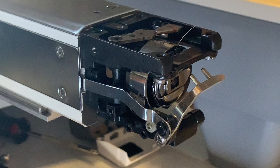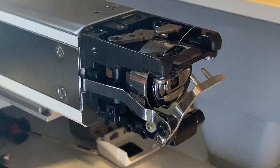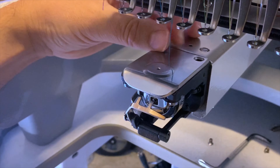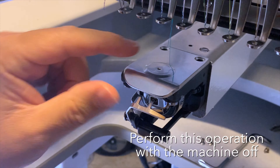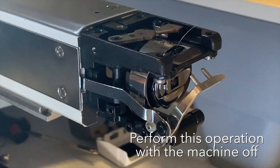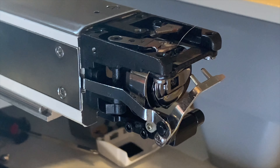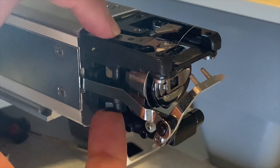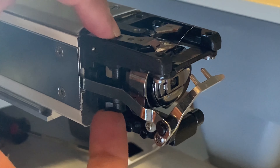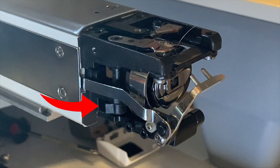In very rare occasions, you may have the issue of the two blades crashing when the machine is trying to perform a trim, and the error code 'trim not in place' shows on the control panel. If this issue is happening to your machine, first you will need to remove the needle plate as well as the rotary hook cover. Then manually open the movable knife to the position shown in this video. Carefully inspect if the movable knife has an up and down play. If it has this play as shown in the video, readjust the lower shaft collar to avoid any play of the movable knife.